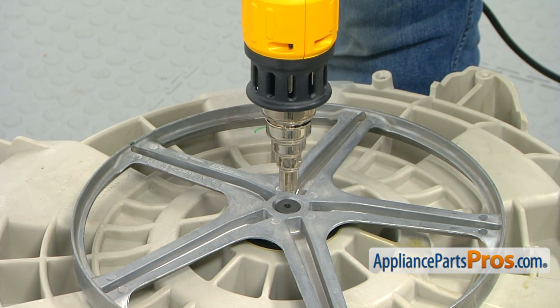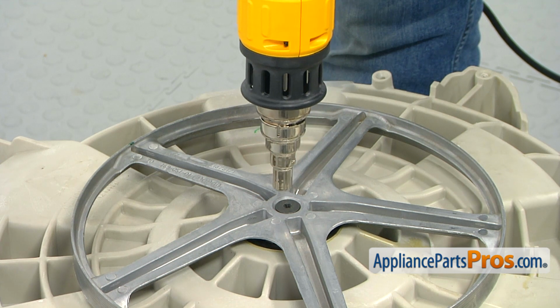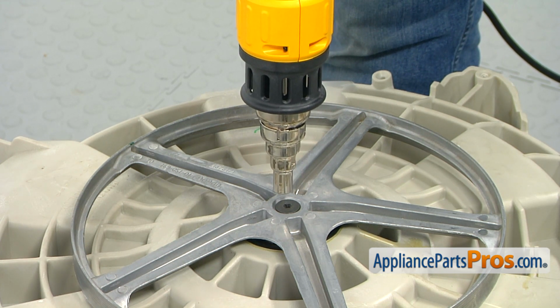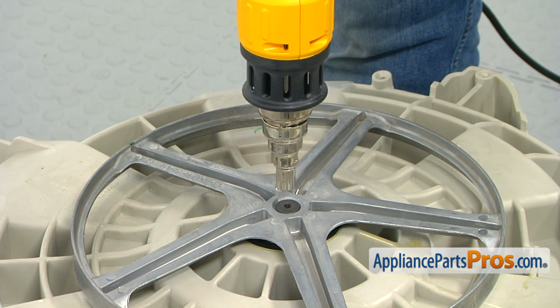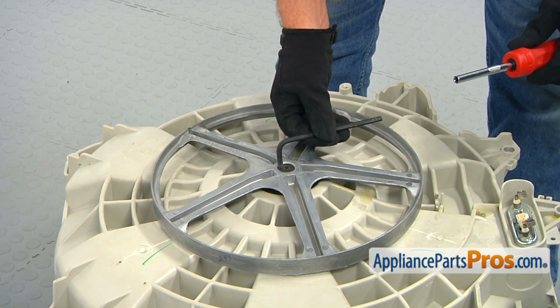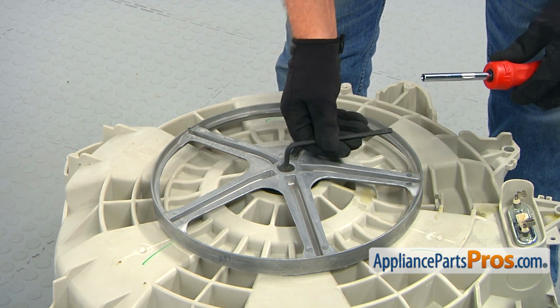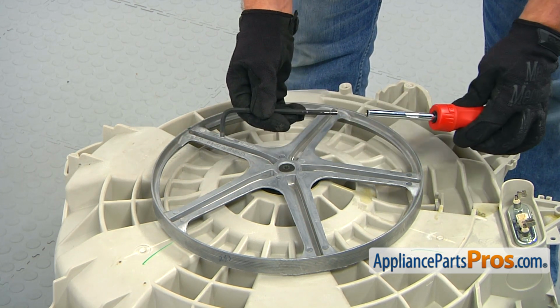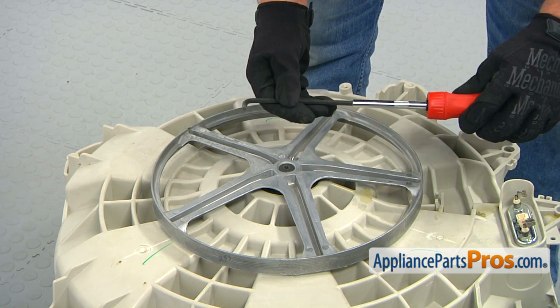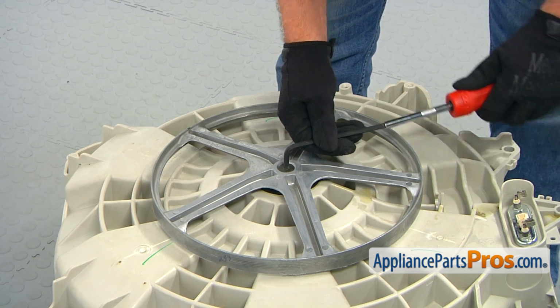On some models, you're probably going to get a regular bolt. In that case, you will use a socket wrench to unscrew it. It's going to be easier. All right, I'm going to use a 6mm Allen wrench to unscrew that bolt, and we need some kind of an extension for the longer lever. I'm using that universal bit driver holder.